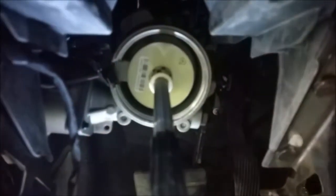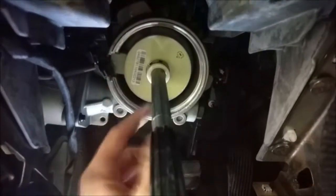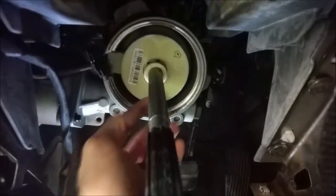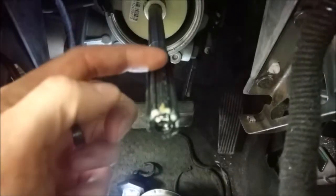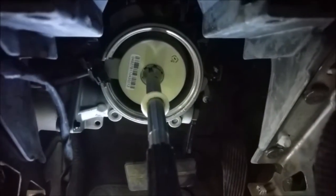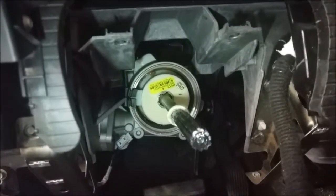There's your automotive-grade what I call the tampon. As you can see, it just sits at the bottom — it never touches the shaft — so it's obviously not stopping dust. This is for when oil and grease separate and that oil goes down the shaft; the tampon will catch it rather than it going over the hump and into the sensor, damaging its life.